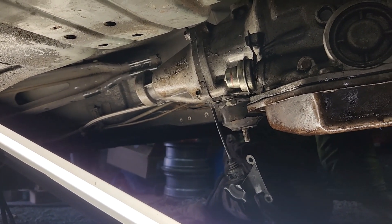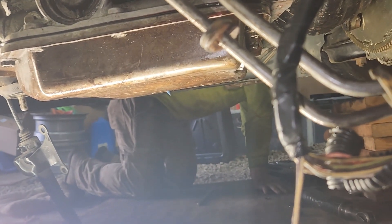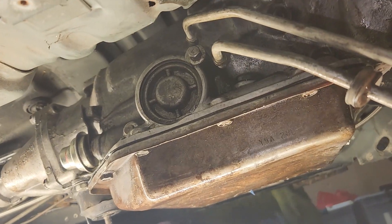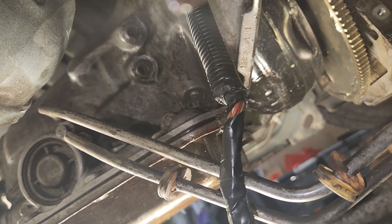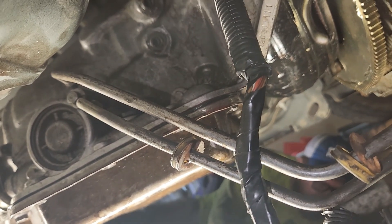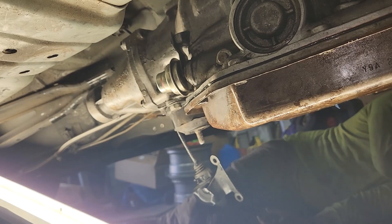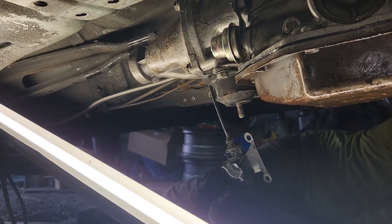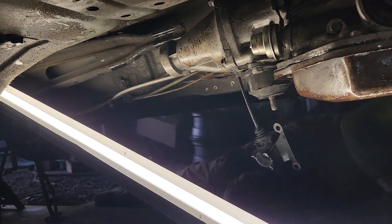Austin's wife and son came over too and we took them home — that's like an hour round trip. But pretty much all that's left is: put the crossmember in, straighten these lines up and put them in the push connectors. I've got some brake line bender tools that'll bend that transmission line just fine, just gotta be careful not to kink it. Line that up, put the torque arm on the crossmember, and figure out a driveshaft. That's pretty much it — y'all have a good one.